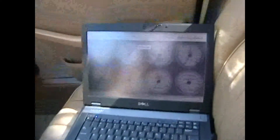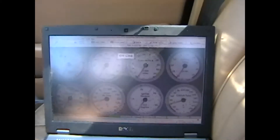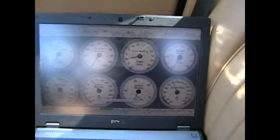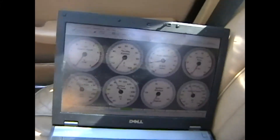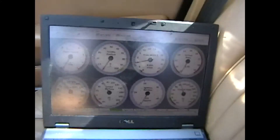The whole system is controlled by the MegaSquirt engine management system — it controls the ignition as well. The MegaSquirt lives back underneath the dashboard here and it's tethered by COM cable back to my laptop. The laptop has information on all the essential ignition parameters, and we'll watch this a little bit as it works.